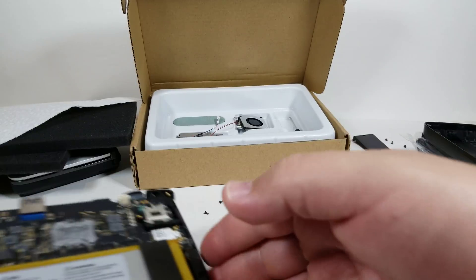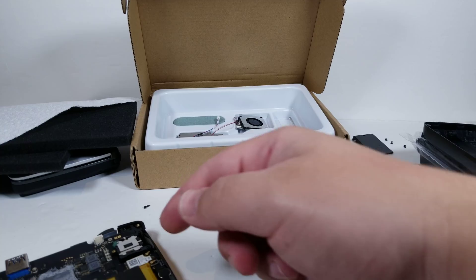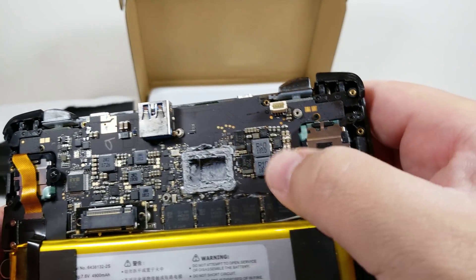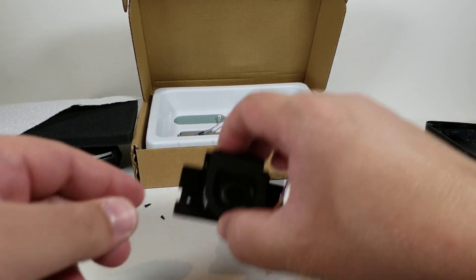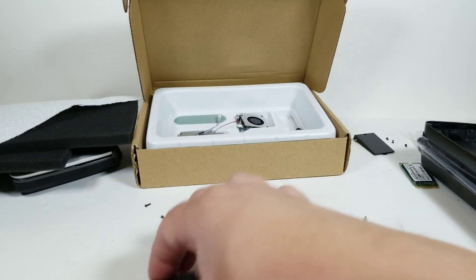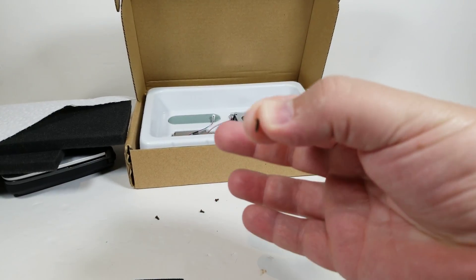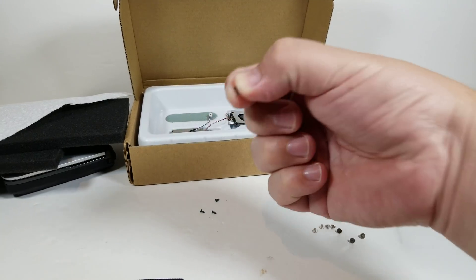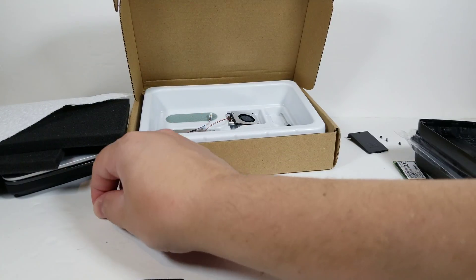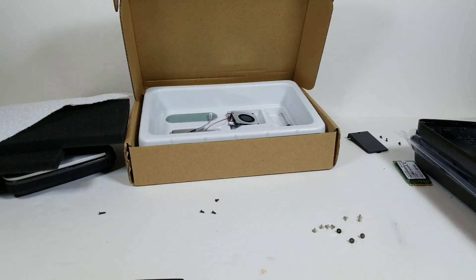You can see this enormous amount of thermal paste that I used before, and it was quite necessary to get good temps. I would also recommend putting paste on this area as well, just so we can cool off some of the chipset over here. The only other thing to be mindful of is this screw that you take out for that post right there — it is the longer screw. There are going to be four screws that hold in the heatsinks. Three are the same size and this one is the longest one, for this post right here. It's technically one of the first ones I'd like to put in, but not screwing all the way. So I'm going to go ahead and clean this out and then we're going to start the process.